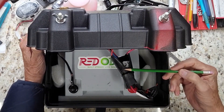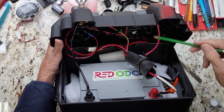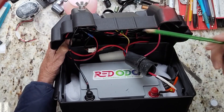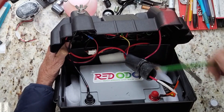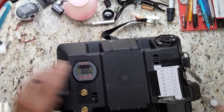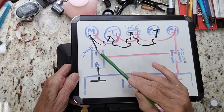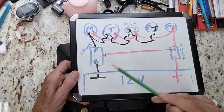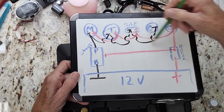Once inside the box you can see where I've got my circuit breaker. I've got several red wires running through different things, but mine are running right back to the circuit breaker itself. My wiring isn't exactly like the drawing — the drawing was a simplistic way of doing it. I'm actually running a red wire to each one of those items individually. This is the circuit breaker that runs into the positive side of the battery. Everything on the negative side is important — you want all your negatives running through your shunt. You don't want to bypass your shunt because that will give you an incorrect reading on your battery. My positives are actually running all the way back to the top of the breaker.